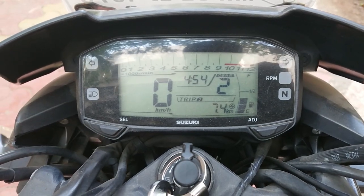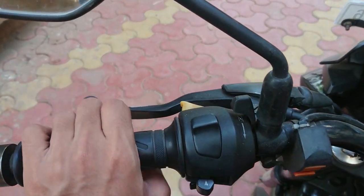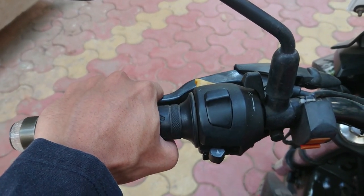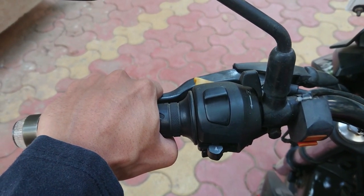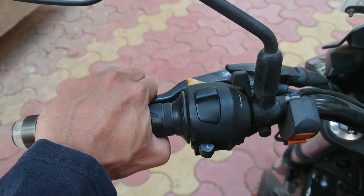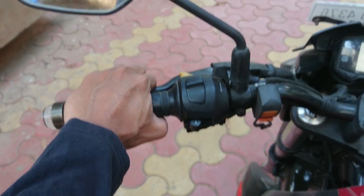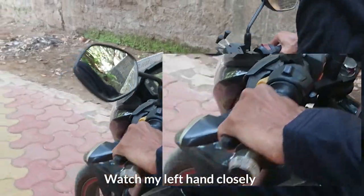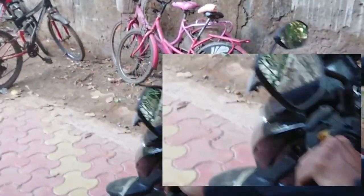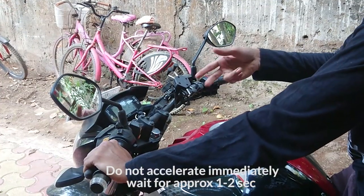You can put your bike into second gear. After putting it in second gear, push your bike and grab your clutch. Then push and release and pull the clutch. This way you can start your bike using the push-start method.